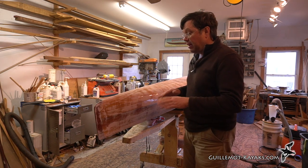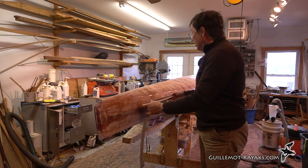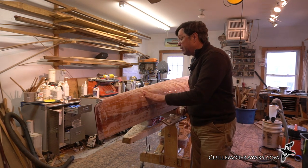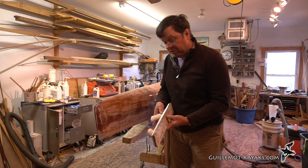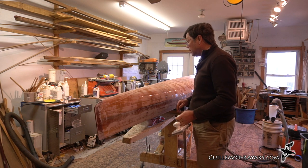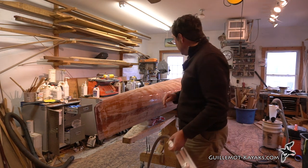The reason the longboard is better is it bridges a longer distance. The longboard is 14 inches long or so. And so it's bridging a bunch of different things as I'm sanding and just knocking down the highest bits. This has a little bit of cushion, so it conforms a little bit, but really it's just going ahead and knocking down those high spots. So things like drips and drools and sags, it's knocking those down first.